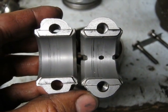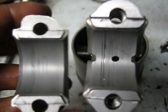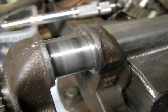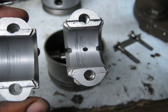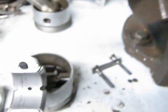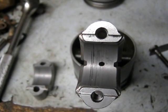Here's what it looks like when I clean the valve lapping compound off — kind of a dull gray finish. You can see the scores in the con rod and in the cap. The crankshaft looks like it's got kind of similar areas on it, but they won't hang my fingernail up, so they're not very deep. I've got to clean all of this off very carefully with brake cleaner or parts washer or a combination of them to get all of the lapping compound out of the surfaces, otherwise it'll tear the engine up in a hurry. I think I've got it loose enough now that it'll actually work in the engine, so it looks like the process may have worked for this particular application.